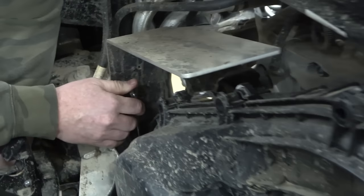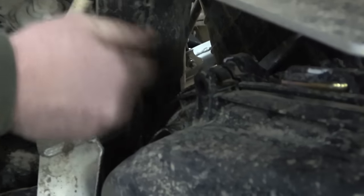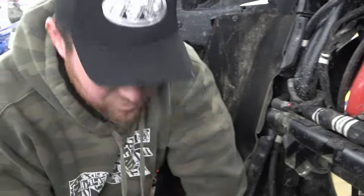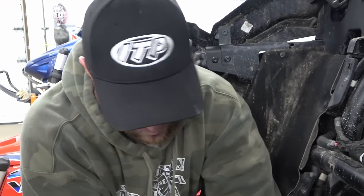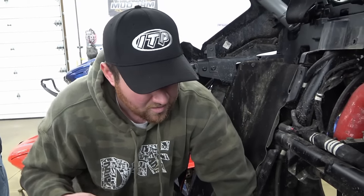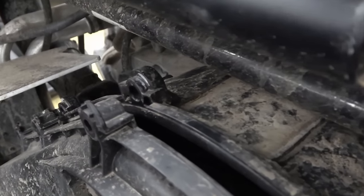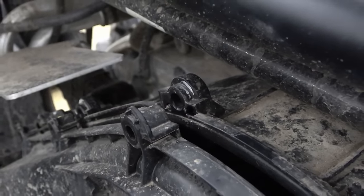Come on, Polaris. Mike, how do you recommend getting this bolt out — should they carry a ratcheting wrench with them? The easiest way I've found is just taking a gear wrench, getting in here, loosening it, getting it off to the point where you can tip the cover and pull it off no problem. One thing to be careful about: on the back side there's actually a little relief where these little square nuts sit in there for the cover so the bolt can thread into them. We've actually had a few of these fall out and get lost, so just be cautious when pulling these out. Make sure they're there when you're taking them off and putting them back in — they also strip super easy.